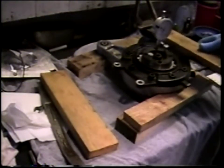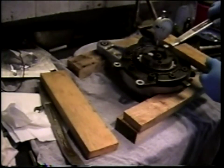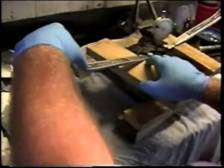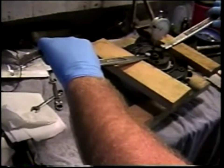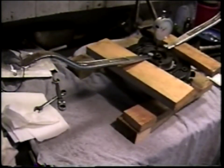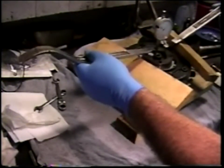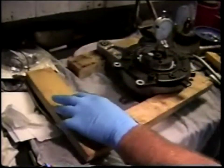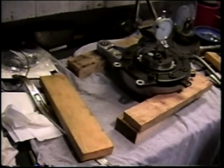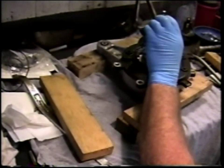So here I am repeating the measurement, and I'm going to do this a number of times until I seem to get the same reading every time. So we slip our tools underneath our bolts, pull up until it doesn't seem to want to come anymore, and we see the dial indicator come up to about 13. And we remove our tools and just push down on this. And this time it popped right back to 0. So it's just a fraction away from where I originally set it.